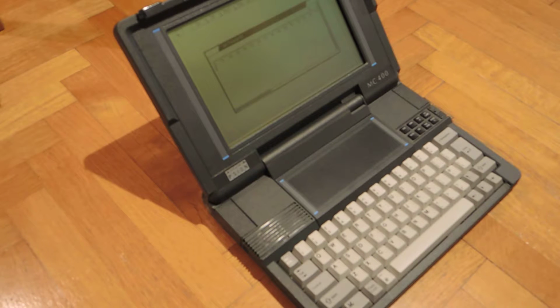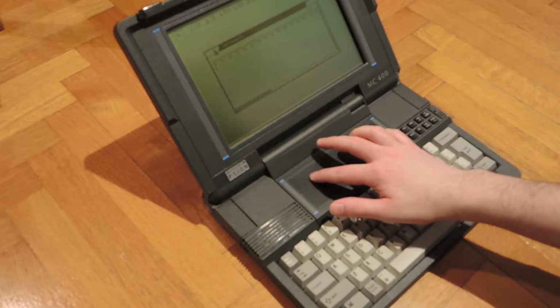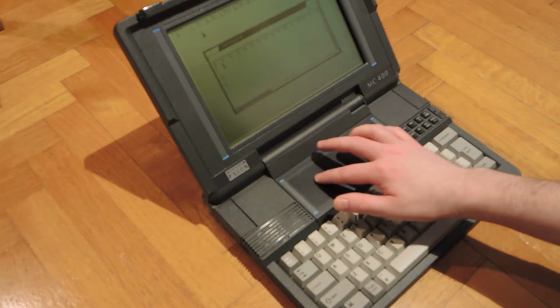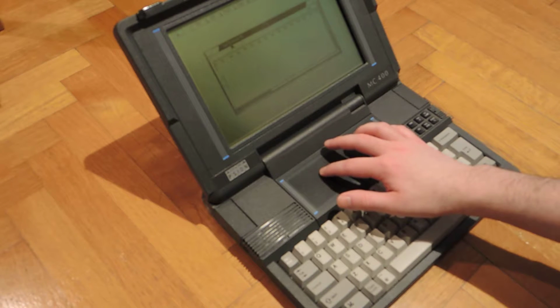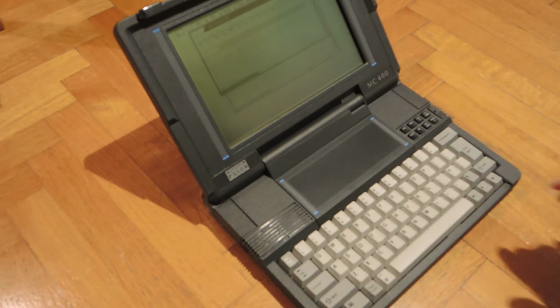I was saying this unit isn't great because it has an older firmware that, aside from having some bugs and lacking some features compared to newer ones, makes it impossible to install many interesting programs that could be installed from cards, like a word processor and the spreadsheet, I think. They just don't run, and the firmware isn't upgradable, so if you were going to buy this, you'd have to make sure you find a seller who knows which firmware is going to be shipped with the machine.